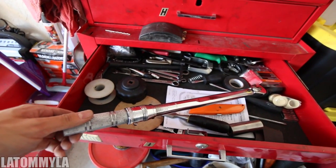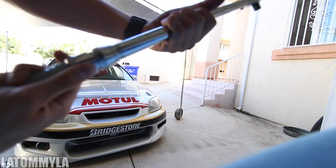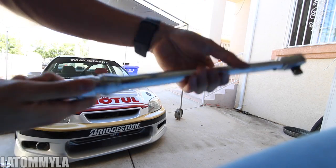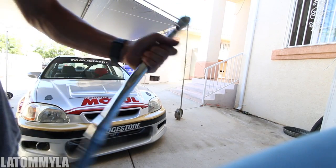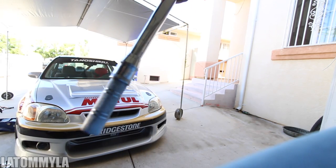You don't want your wheels flying off when you're driving. I do 85 foot-pounds — it's spec'd at 80, but I do 85 just in case. You know, 5 extra pounds is not that much. And this is the Craftsman torque wrench. You can use Harbor Freight — the Harbor Freight was actually pretty accurate, but I'm so used to this one and it's in the garage.